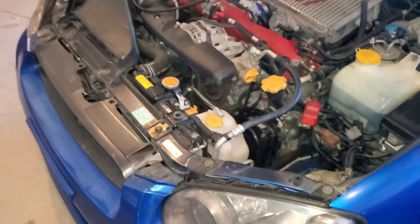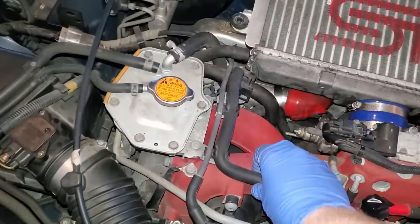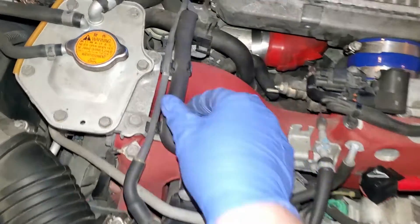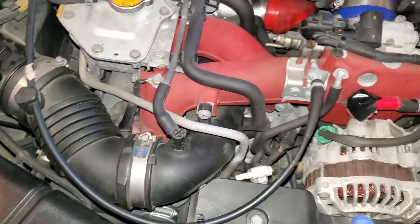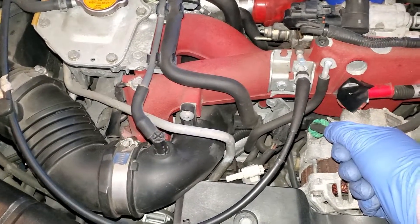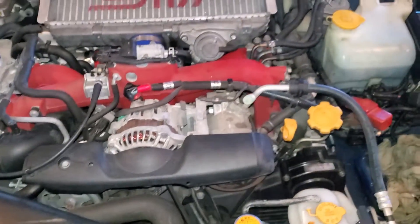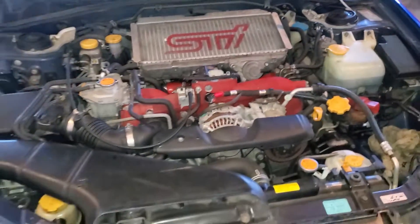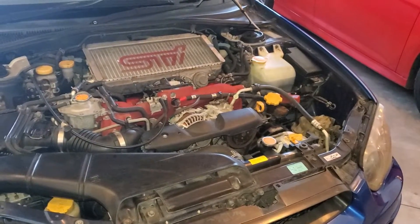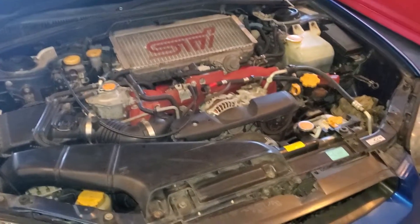I think I'm going to end the video here. Make sure if you buy one of these, go through the PCV system and make sure it's all good, because it is getting moisture in there. This is rock hard — you can see the perma-indents — and it's attached to the intake, so I have to be very careful taking that off because it's plastic. That's the joys of having plastic rubber hoses 15 years later. As always, hope you guys enjoyed the video — clean your PCV systems if you buy an STI. Give it a thumbs up, like and subscribe. Peace!